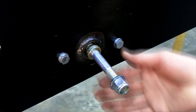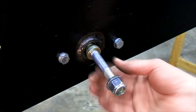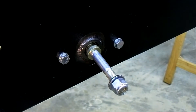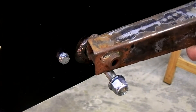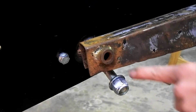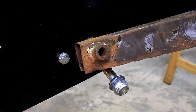The benefit of this is that all this extra range of motion will give us more adjustment and more accurate adjustment of the rear camber as well as the rear toe, and this will also remove a little bit of friction. This spacing between those two washers will hold the radius arm. I have an unrestored radius arm here - this will slide on like this, but before we can do that we need to enlarge this hole from about 10 millimeters to a half an inch so that it will fit over this bolt. I'll show you how we're going to do that in one of the next videos when we completely restore the radius arm.